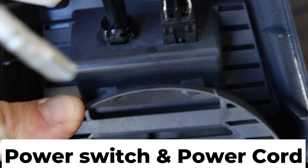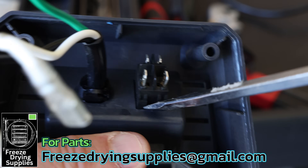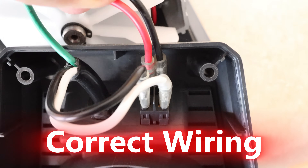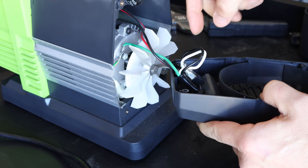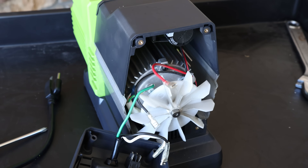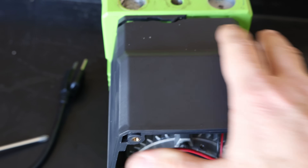To remove the switch, there are two pressure tabs — one on each side and one on the back. Push in on both sides simultaneously and it will fall through the opening. To remove the power cord, push the little plastic piece to allow the cord to slip through. Getting better access requires removing the top cover, which in a normal circumstance needs three screws — one way back in the center and one on each side — requiring a very long allen key.